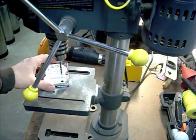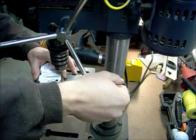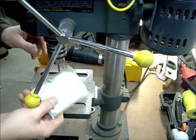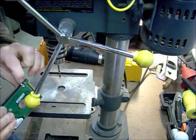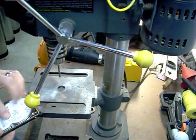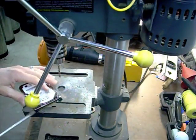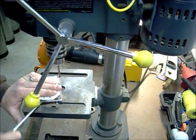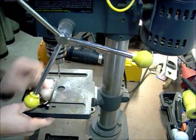Just a few shots of that so you can see what I'm talking about with the inside of a hard drive. I have to usually track down exactly where it is. These two and a half inch drives have a cover, a cap that comes over the top of them. A lot of the three and a halfs simply have a plate on top. So once you get to that point, you need a screwdriver usually — something to pry it up with. We're not trying to save anything on here except the platters. You've got to be careful where you pry it.